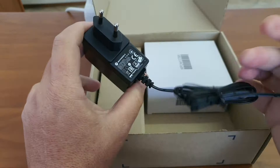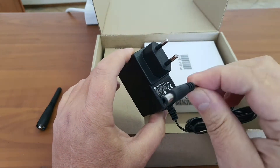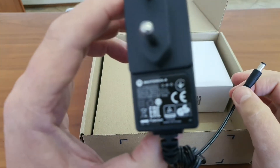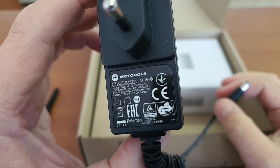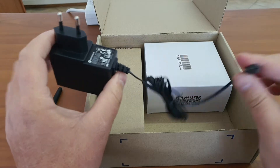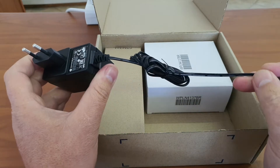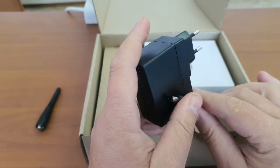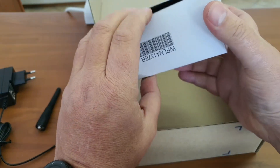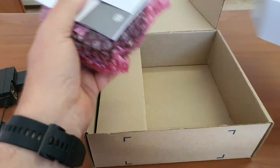The charger has a two-prong plug, which I don't like. This seems to be the standard for all these chargers — a two-point plug. Make sure if you have these that you have adapters available. It appears to be a normal 2.5mm DC plug with a 14 volt output. This will probably work if you make your own 12 volt supply cable for a vehicle, but I'm not sure of the tolerance — whether the charger will allow you to go down to around 13.5 volts when the alternator is working.